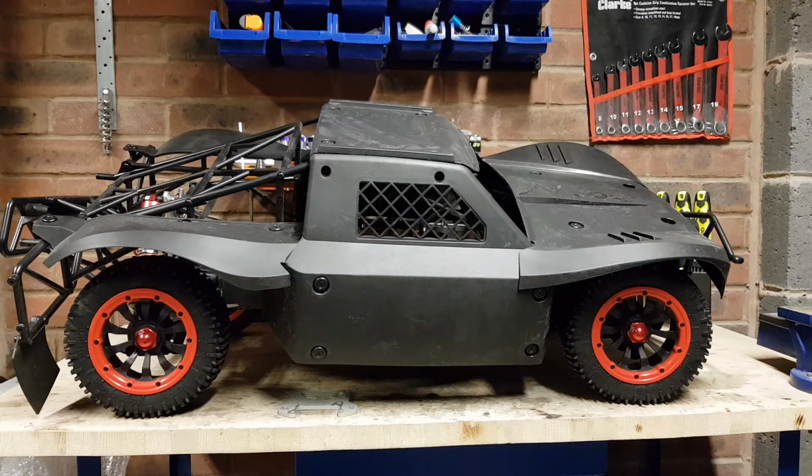What else happened on my X2? Pull starter broke. I think I only started it 3 times. When that one broke, it just completely disintegrated. The compound on the clutch fell off. It wasn't glued properly. But again, taking this one apart, the clutch even looked better. So when you weigh up the price difference of 50 quid between this and the basic X2 model, this is easily worth the extra money. For argument's sake, if the diffs in the X2 haven't been fixed, and you go with the cheapest option to fix the diffs, 20 quid per diff, you're 10 quid out of what this costs already.